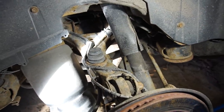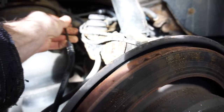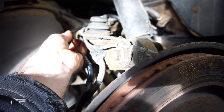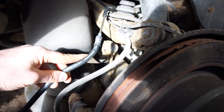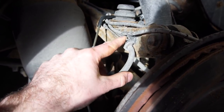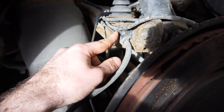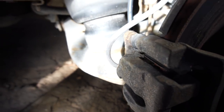I'm just going to film this one side. The brake hoses are different for right and left, but this one seems to be the correct one for this side — the other one has to bend the other way. This one lays out and looks to be exactly the same as the old ones, so it should fit nicely. I just need to spray these plastic mounting clips with some penetrating fluid, get those loose, and start removing the caliper again.